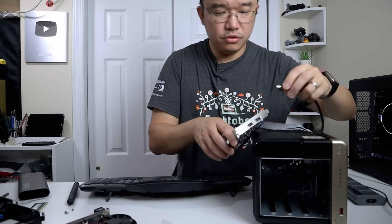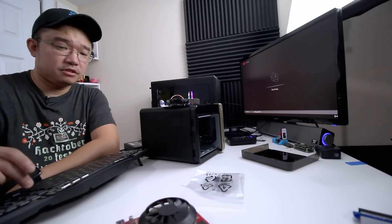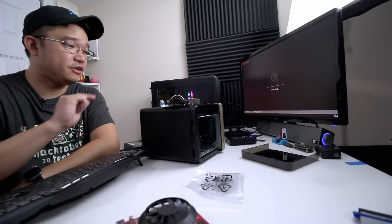I'm going to try a GT 1030 that requires almost next to no power. I put it in and that powers up with the 1030 in there. So the 750 Ti was probably drawing a little too much wattage through the PCIe port. Now I'm going to move the HDMI cable over to the 1030 and see if this powers on — I have a suspicion it might not display through the discrete card. But after POST — that beep you hear — let's see. The beep is there, still no signal, give it about ten seconds... There you go — graphics just popped up using the 1030. Graphic cards do work on this thing.